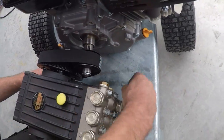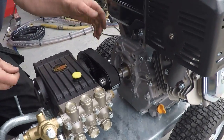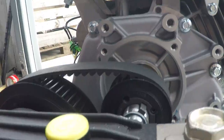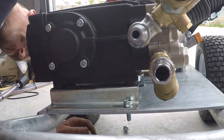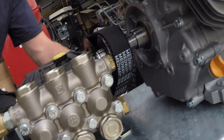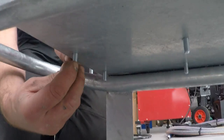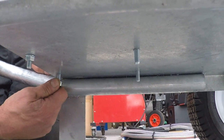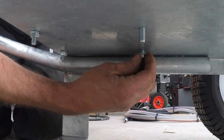First of all, take your belt and put both sides on. You can see these teeth — sometimes they don't sit fully down into the grooves, so set it on roughly. Put your bolts in: one, two, three, four. Get your four nuts — these are usually lovely little serrated nuts that cut into steel and lock themselves into position. Tighten those up.